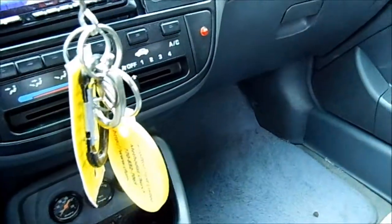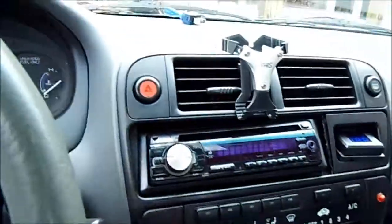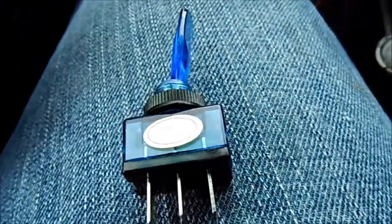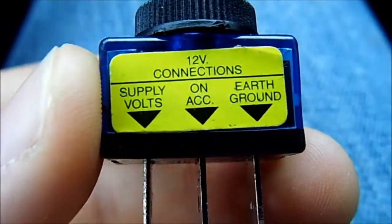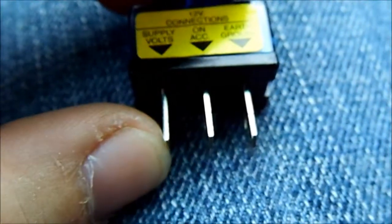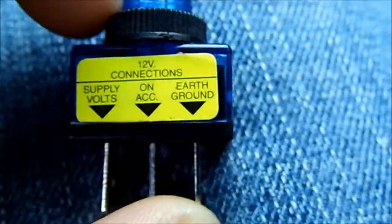My main focus of this video is I need to put an update out there. This is my blue toggle switch — I had this in the Blazer. They're really easy. I had it running to my amp — you just have a 12 volt coming in, then the middle one is your remote wire for your amp, and just any ground, and that's about it.